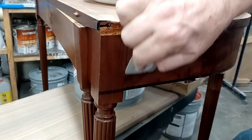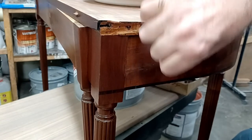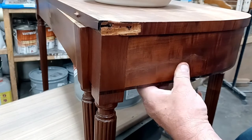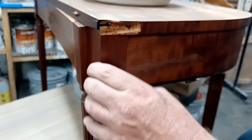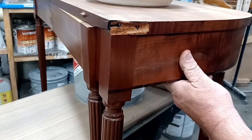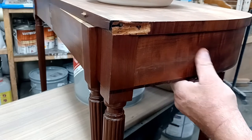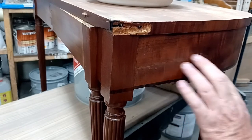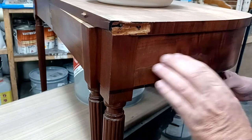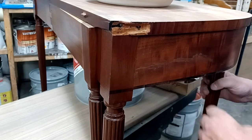It's just a very simple way to remove a bunch of wax at once without damaging the varnish. You could use the Scotch-Brite to remove all the wax, but I feel it tends to take too much wax out of the scratch itself — because it tends to form itself to the scratch — and then you end up with the scratch being back there. So I use a combination of both: the plastic card and the Scotch-Brite.